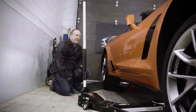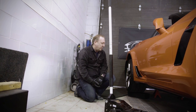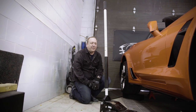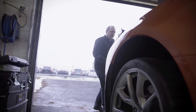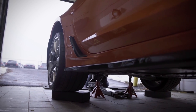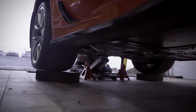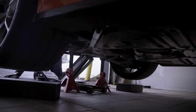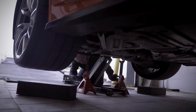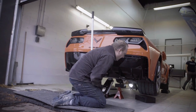The car is now officially on four jacks. I'm going to take my jack, set it in the back in the middle of the cradle, and rest it there for extra insurance. I'm always trying to find extra ways to limit a fall if something were to happen. The car is fully rested on the jack stands — I've gone two notches before the end, so I'm not at the limit of the jack stand. We're ready to start working on the car.